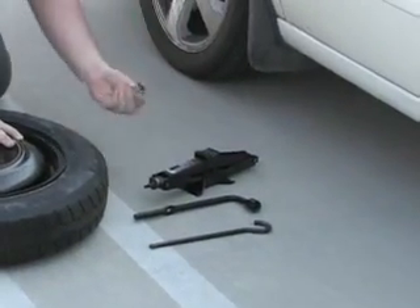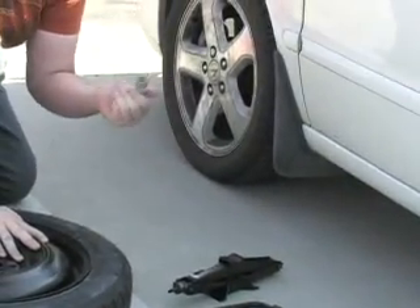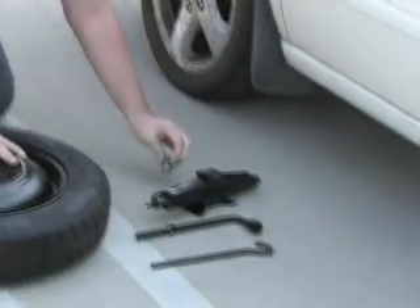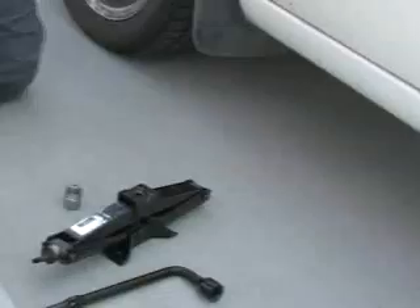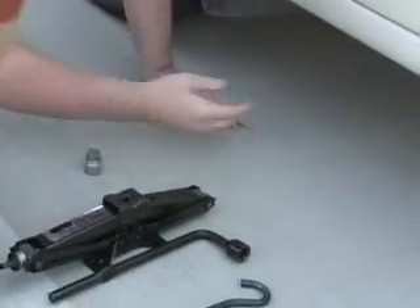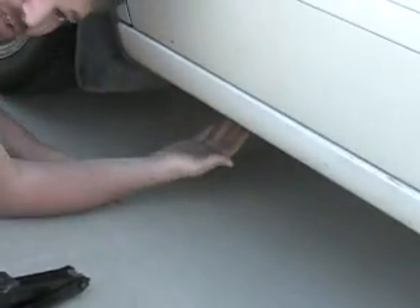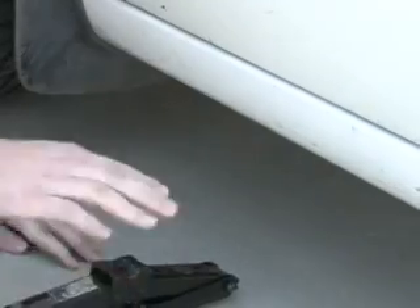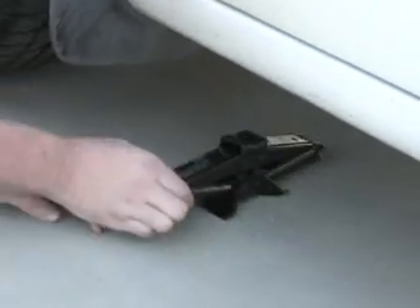On this specific car, we actually also have the lug nut key, to deter people from stealing the rims off your car. The first thing we're going to do is look up under the car and look for the folded piece of metal — that's going to be our jack point. That's where you want to have the jack centered to jack up this portion of the car.